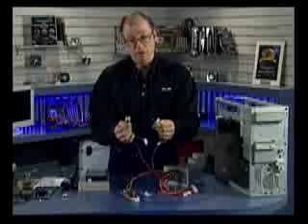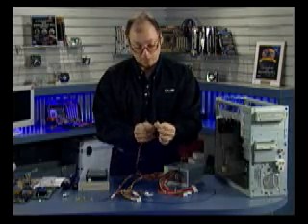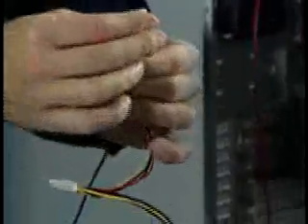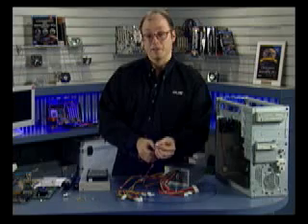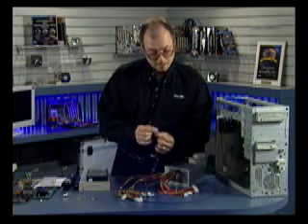I'll probably pick one of these for the CD-ROM drive, one for the hard drive, and then one of these smaller connectors for the floppy. Now, it's important that you get these connectors in right. The larger ones are pretty foolproof, but the smaller one for the floppy drive has been a little bit of trouble. I've seen over the last couple of years in my own classes at least two or three floppy drives get smoked right in front of me — and it's amazing, but it happens.